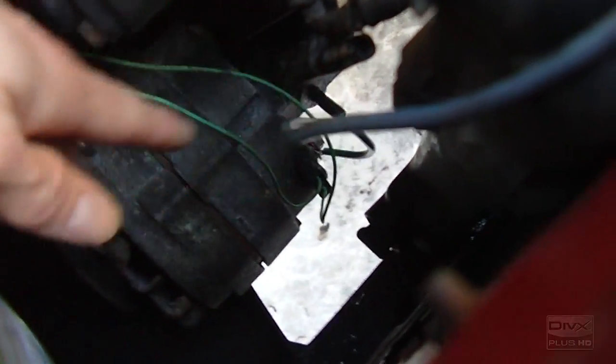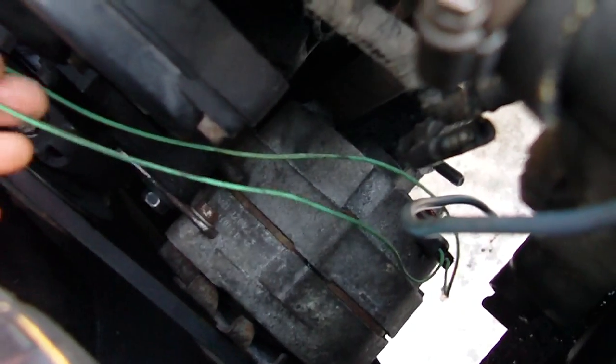Now it only works with this van setup here, but you can just connect an alternator wherever you want if you can build the brackets for it. It's not always cut and dry, but this worked out pretty well. So on these alternators, you only have 3 wires. One is the main wire, the large wire that comes off of the bolt there, and that just goes over to the battery, so it's just connected to the battery terminal there. And then you have 2 other wires. One wire is the dummy light, and I believe that's number 1. And number 2 just goes to 12 volts. And so that goes to your ignition.